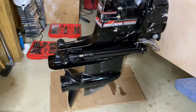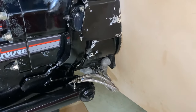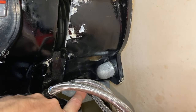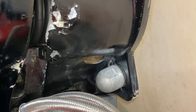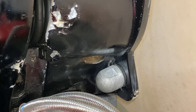We'll direct our attention to the bell housing or lower transom anode and the two small anodes on either side — starboard and port side. Now to a closer view of the lower starboard side of our transom. These are the hydraulic lines or hoses that feed off of the trim ram and into the hard-mounted fittings directly between the lower bell housing and transom anode and the lower portion of the transom. Here is the starboard side anode — what a significant difference from the one we showed you on the workbench. We chose magnesium because that is the best-suited anode kit for freshwater operation. These little engineered flat spots are for a wrench — those flat spots are purposely engineered on your anode. On the corroded one inside, you really couldn't see those flat spots because of the amount of corrosion each of those circular anodes absorbed over the years.